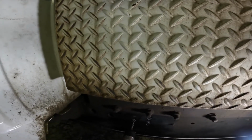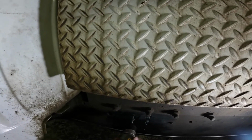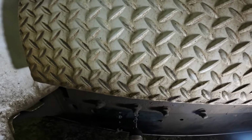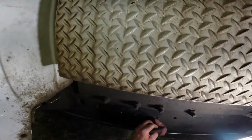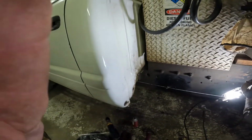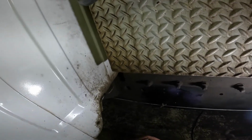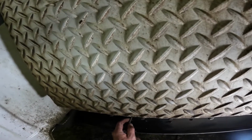All right. Now, I know this is just a small hole. Just kind of ream it out a little bit. Take my rag. Now, I'm going to pause for a sec. All right, got me a ratchet and a 1/4 inch square socket, which I actually have one in hand, so I can actually drive this tap in.